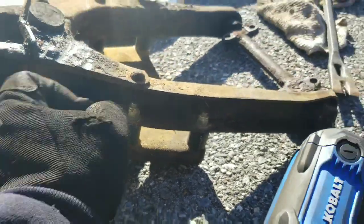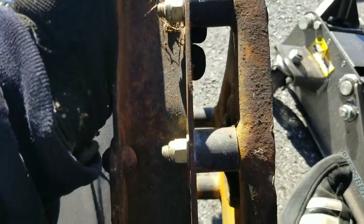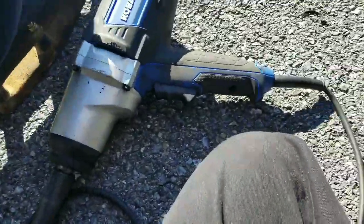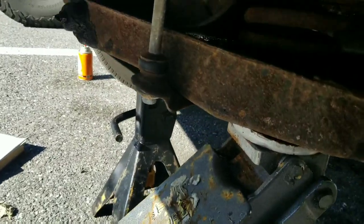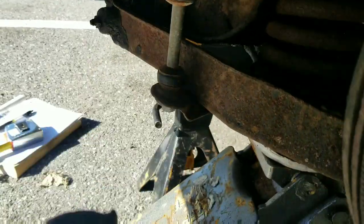When I had my 54, I drilled out the rivets and put in some bolts. I made these spacers — they're one inch spacers out of aluminum, solid bar, cut them and drilled them, grade 8 bolts — and it dropped the wheel about two inches. I took my measurements beforehand so we can see exactly what happens. Now I'm going to start going to work — I believe that's a 9/16 right there.